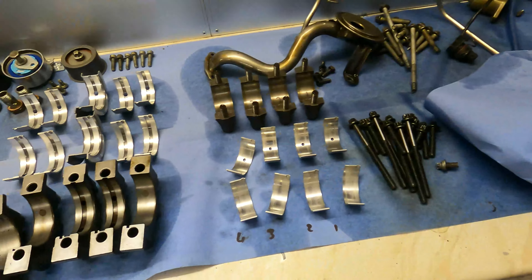I've got those two teeth and my one at the top because the real timing marks are here, here and here. So we're only just slightly after top dead centre. I'm happy we're all lined up to how it came out. And we are bang on — got this one, this one and this one. Now my timing marks are here and here, so when the next person does the cam belt they're going to wonder what these are. No valves here. Now I'm happy, we can put the sump back on.